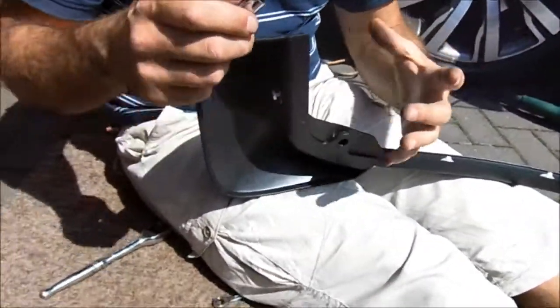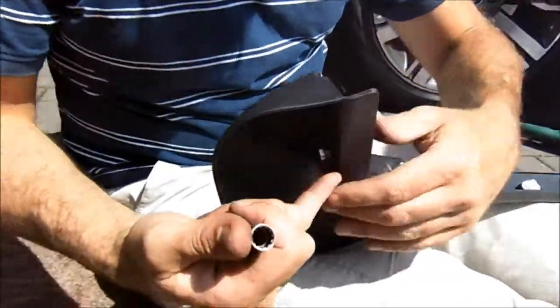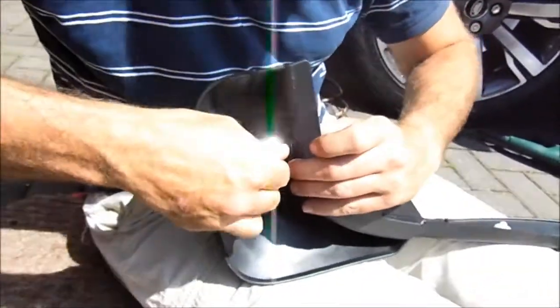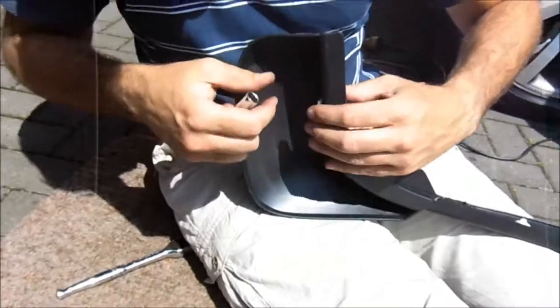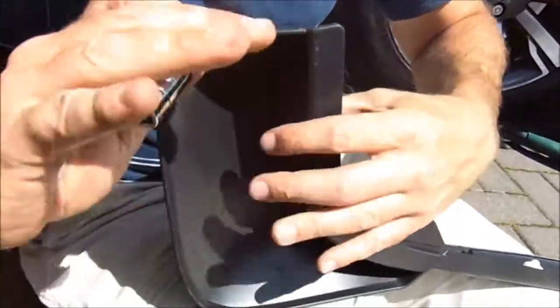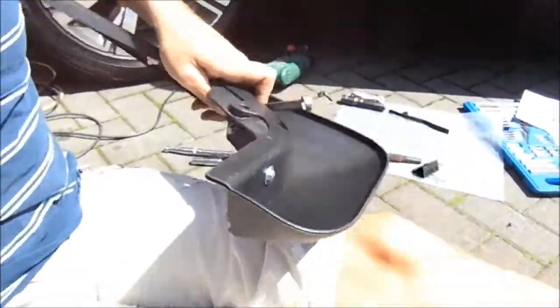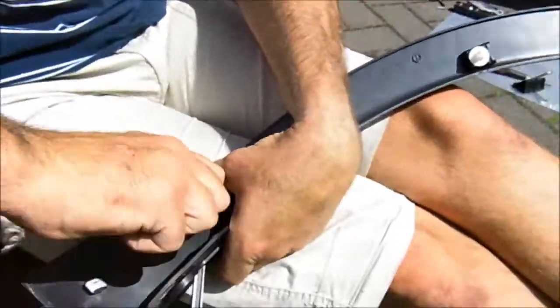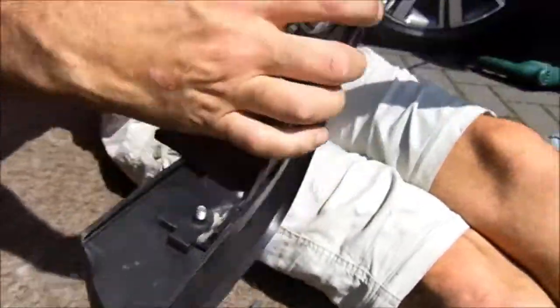So as you can see, it's not difficult — it's just trying to get it at the right angle while filming at the same time. When you come to do this it'll be much easier because you're not worried about the camera. I've just got both bolts in now, they're both sort of loose, and I'll just put the spanner on here and tighten it up. In the instructions it says don't tighten to any more than nine newton metres — in plain English that just means don't tighten more than hand tight, because all you'll do is distort the plastic. So we've just had to go and get a ring spanner. Put that on there and hold it there. Again, you don't need to be any more than hand tight because you'll distort all the plastic.